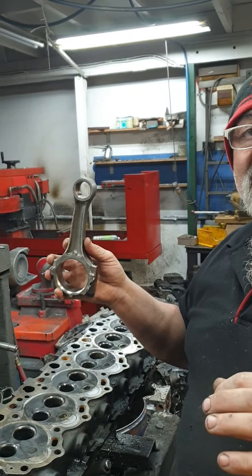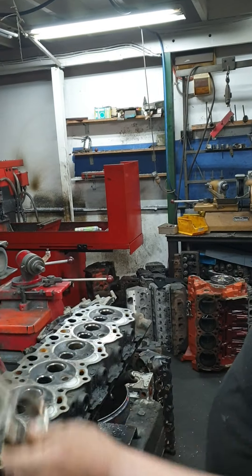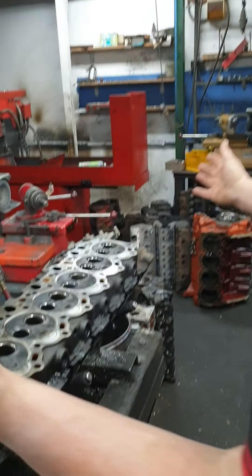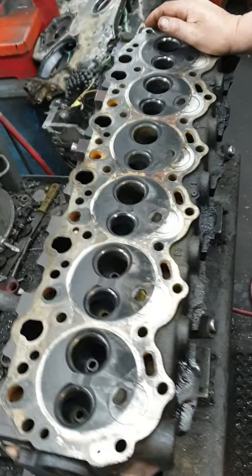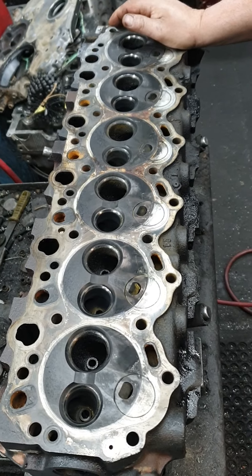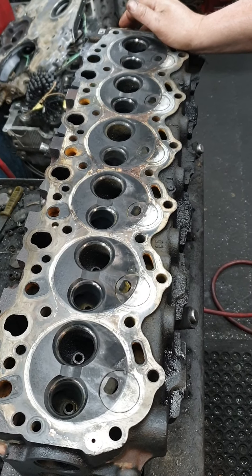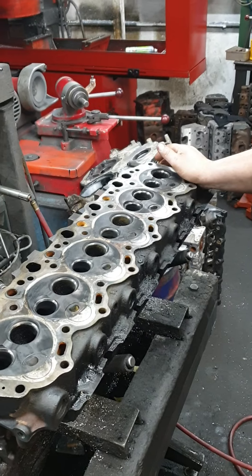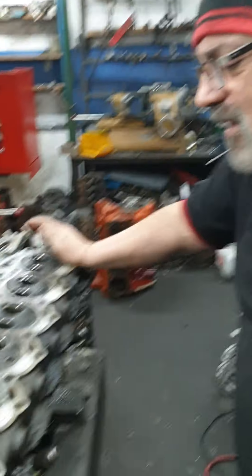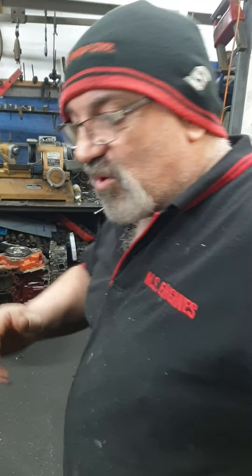This is water that's done this. So we've got the bent conrod — we know that's bent in the engine. I've got the head here. Look at this, it looks good, doesn't it? And I suspect this is cracked. You can't see nothing, can you? How can you tell? I'm going to test it. I'm going to show you something. I know this is cracked — I'm not even going to wash it, clean it, or blast it. I know it's cracked. I'm going to show you how I do a quick crack test, and I'm going to write this head off.